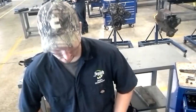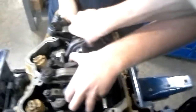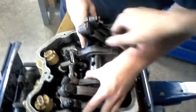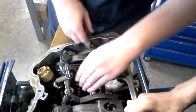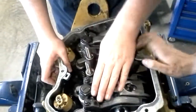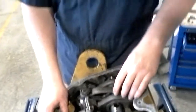Kyle, you're going to have to help me out with this. I'll lift one side and you'll have to sort of play with it to make sure everything is aligned. Make sure your injector rocker is aligned, your intake rocker is aligned, and your exhaust valve rocker is aligned. You're just basically going to have to play with it, but it does go into position.